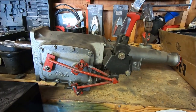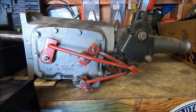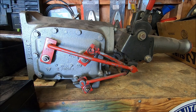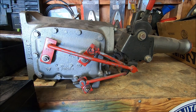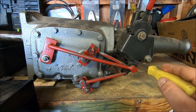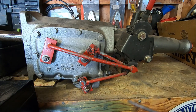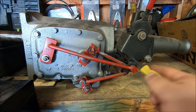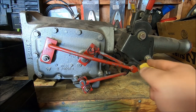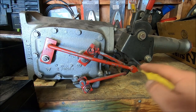So we're just going to get straight into it. On a Hurst shifter, there's actually a really nifty place - unfortunately I can't really show you - but it's right here. There's a little half-moon. And if you take a nail, or I found a screwdriver works even better because it's the perfect diameter, you ought to be able to slip it through everything. And that finds you true neutral.